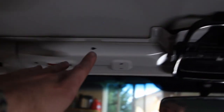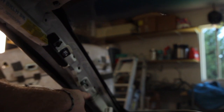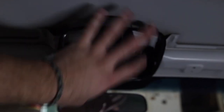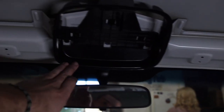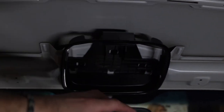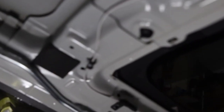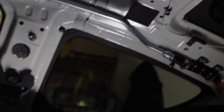The roof is pretty simple to take off. Remove all the visors and the lights. There's going to be one wire you'll have to unclip. The centerpiece is actually part of the clip of the roof, so you remove that — there are two Phillips screws underneath in the glasses compartment. Unscrew those two, pop it out, and the roof just drops. In the rear of the headliner there are four clips. They're a bit difficult but you can get them out.